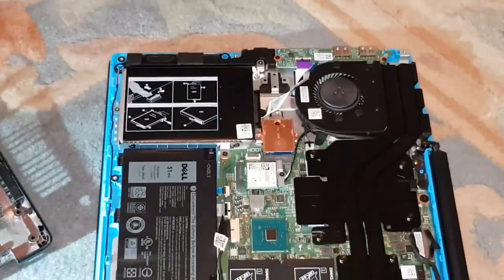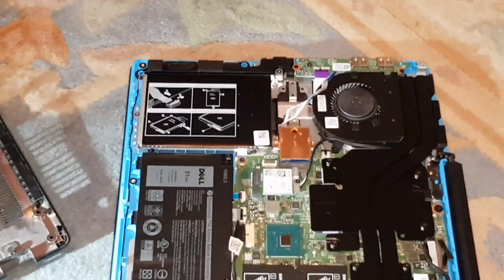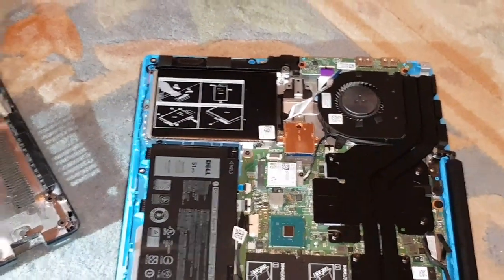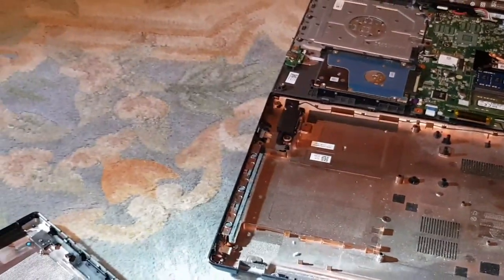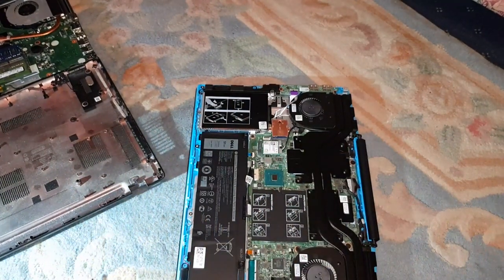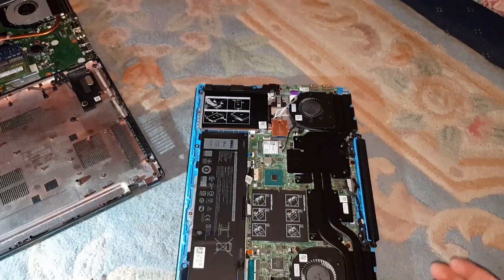Alright, the new hard drive is in — that's the new drive, and my old one is in there. All you do is connect that connector back up, then put the screws back in. To close it up, get the case, push it back in place, squish it together, keep pressing it hard, and then it's in. Simple — easy to take off, easy to put on. Then you screw it all back up. Thank you guys for watching, please subscribe to my channel. See you guys next time, goodbye.